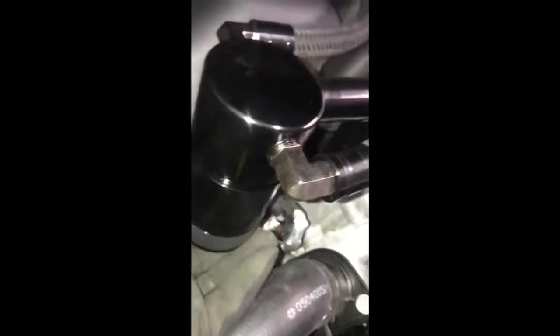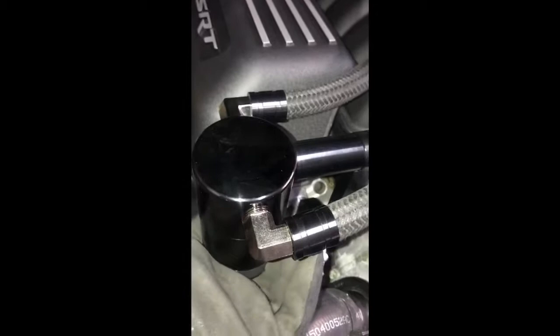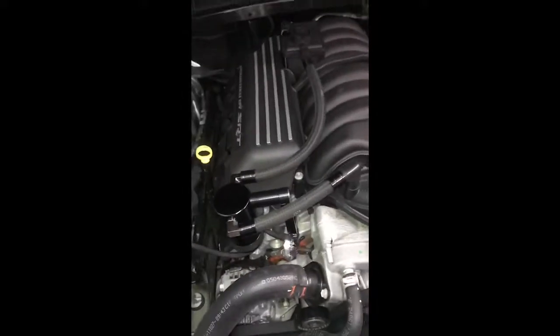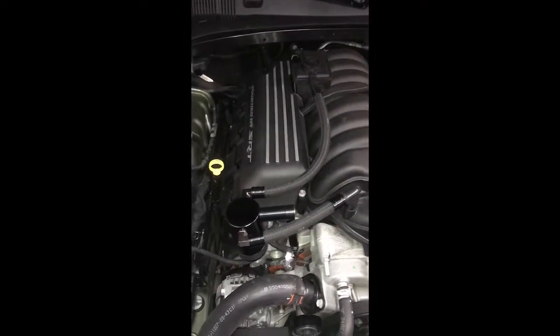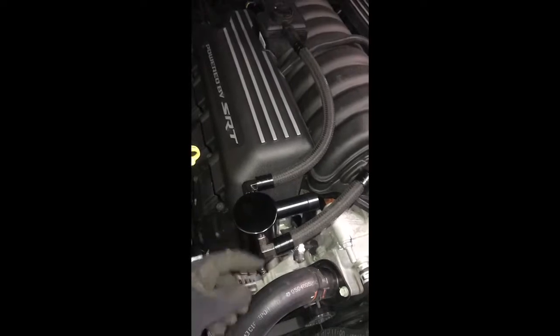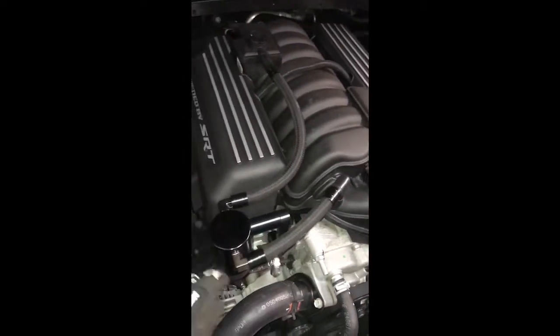And you can just check your oil level. Obviously it's empty now. One thing it does note, which is probably pretty smart, is that there is a little rubber washer on the top of these threads in here. And again, you're not trying to manhandle any of this stuff. You're not going to spring a leak on anything like this. So you can feel it get snug. Just a little bit. I mean, that's about it. You're not trying to kill anything here. You just want to make sure that things are tight, just in case this fills up and it's kind of sloshing, nothing can get through. Just enough seal to let that filter work,